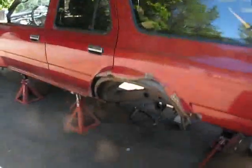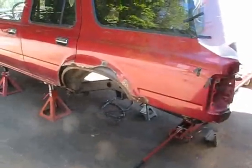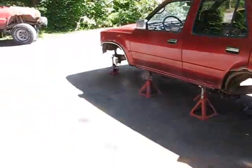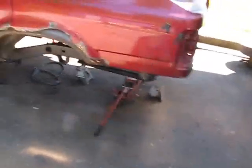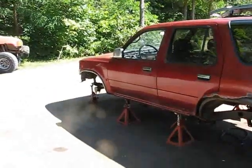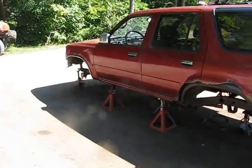Hi, Riley. Hello. Okay, well, I just finished taking care of a bunch of stuff and eating, so now it's crunch time. I really gotta get hammered on this. I have 5 weeks to get this 4Runner driving. Yeah, I'm a little bit stressed out. So now, I gotta measure the front two, or the number two body pucks, and figure out how much I need to cut off them. Once I get that done, I can bolt the body down for good.